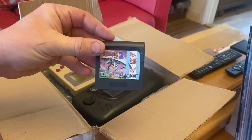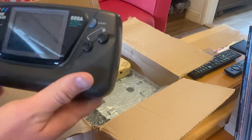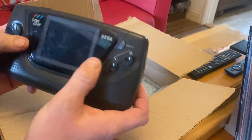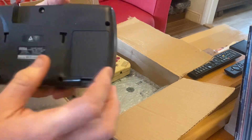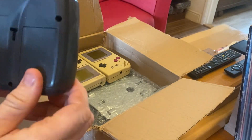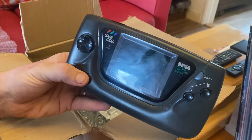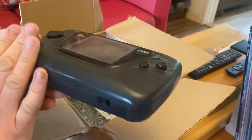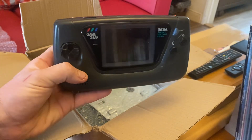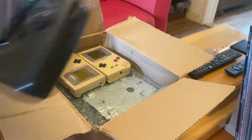Sonic 2 — I didn't realise that was coming. Now the second Game Gear looks pretty clean, pretty good. This one looks like it has the original bezel on it, but this one looks a little bit scruffy. Contacts look good on both, so I'm guessing they just need recapping. We'll recap them and see if they fire up, and if the screen doesn't work we can replace the screen.